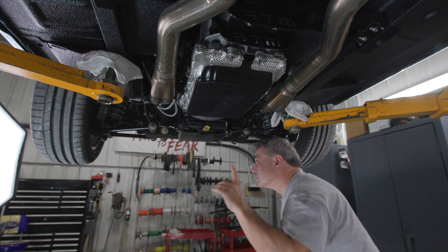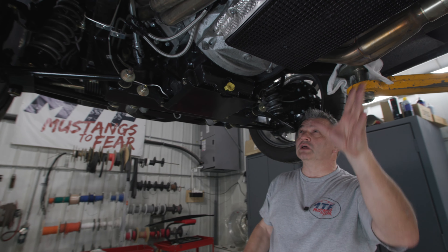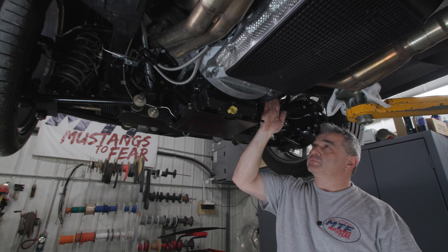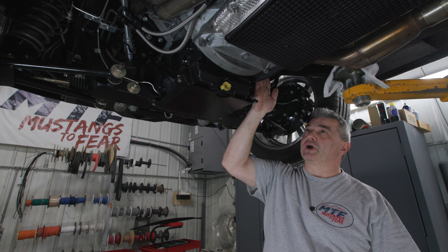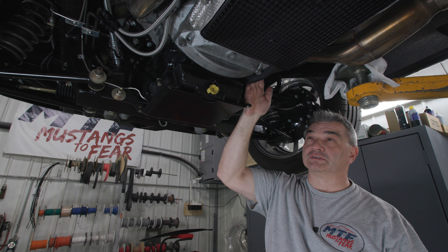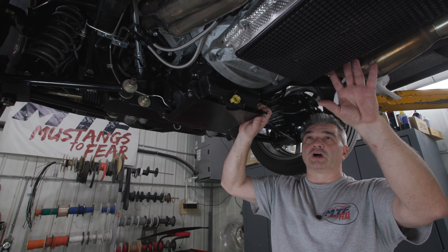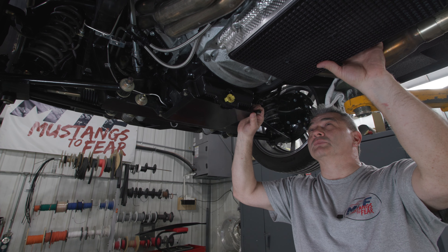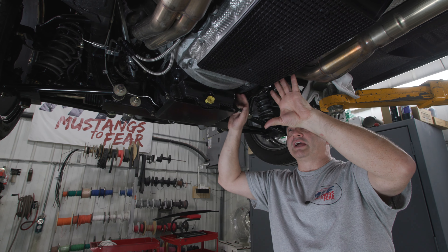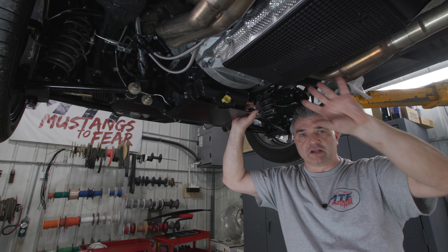The other thing to think about is that if you're redoing a car and thinking about the Coyote 10-speed, there is an OEM transmission bracket at the entrance of the tunnel — you'll need to remove that to allow as much room as possible for your retrofit, for your swap. You want that opening large enough, wide enough, and smooth enough to accommodate a wide variety of transmissions.